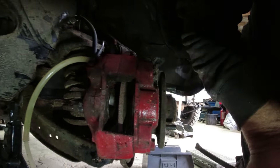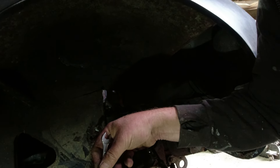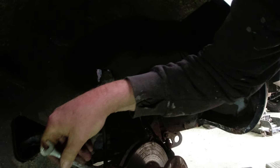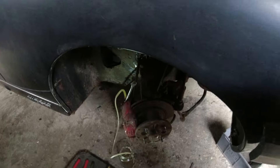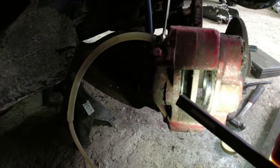The pistons are moving. Let me do this nut up to get enough hydraulic pressure to push the pistons out and see their condition. Both pistons moved and have come out - there are signs of corrosion on those pistons. They're probably due for a refurb. Let's see now if we've got any brake fluid out the back yet - yes we have. When I cut a brake line that's sort of what I'd expect to happen - so it's probably all air up to this corner.